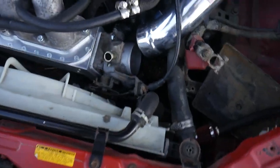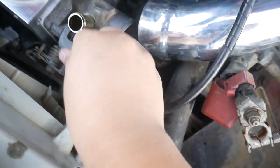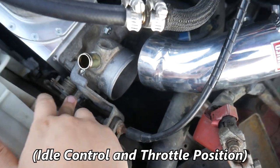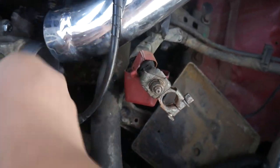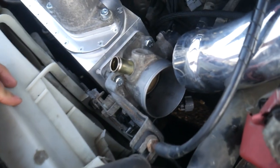That's when disaster struck. I've run into a problem with wiring, vacuum hose fitment, and overall fit. I need to extend the wiring harness for two sensors — one on each side, possibly intake temp and idle control. The throttle body position changed and is now coming straight out, so I need to extend the wires and get a longer hose. I also need to cut off one fin on the fan shroud so the throttle cable will actually fit.